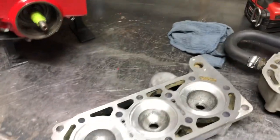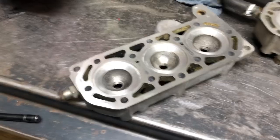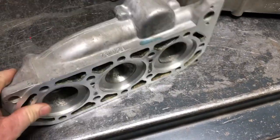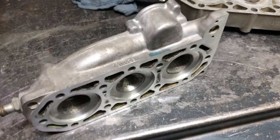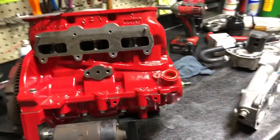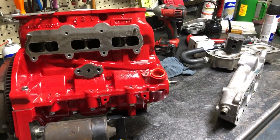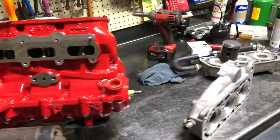So that's something you can't do. But this was old-school tuning — this is how they handled the problem of how do we keep the head from warping: do it to the block. Today we cut the heads all the time. Don't worry about it too much. There are some non-JM heads which are a little bit harder to work with because they can warp a bit. Milling the head is kind of a personal preference; I'm not a huge fan of it in most cases, but you certainly can do it.